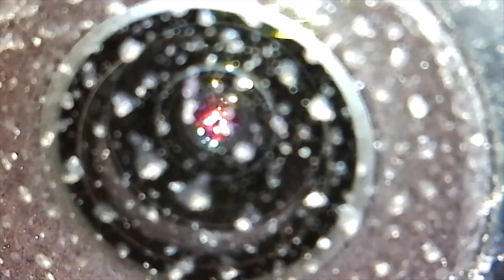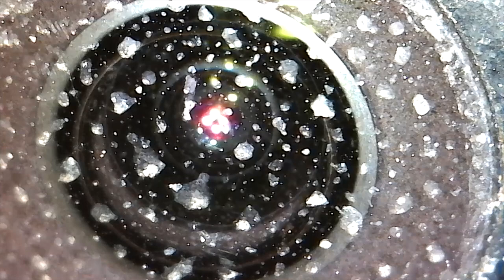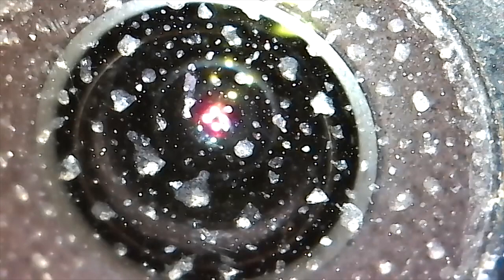I'm going to go through focus here now. Let me back up nice and slow so you can see. Now there's the guts of the camera — we're actually focused on the metal inside of the camera underneath where the lens is. And now I'm going to continue changing focus and pull it towards me. I want you to take a look at about the two o'clock position. If you don't think this stuff is scratchy, look at the shape of that piece shown here by the green arrow — you don't think that that's going to scratch the lens? Well it certainly will. So now you have a good idea what your cameras are fighting on a daily basis as you drive your car.